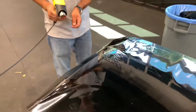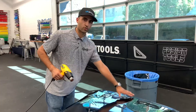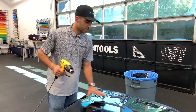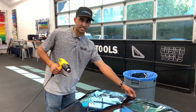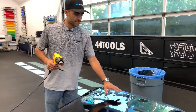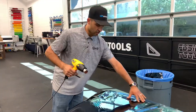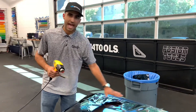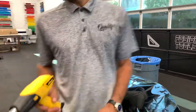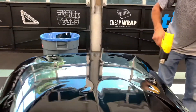One thing I want to point out: I'm going to stay away from the middle. The natural tendency is to want to shrink where it's easy — it's like a magnet to the easy spot. You have to focus on not going to where it's easy. I want the difficulty to shift to where it's easy. If you go in the middle, you're pinching it off and making the edges harder. So I'm not going to go in the middle at all. If you're just starting, you want to work nice and evenly. Watch my wrist, watch how close I am.